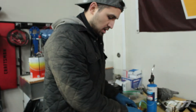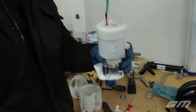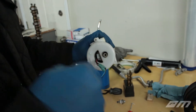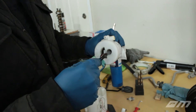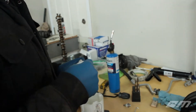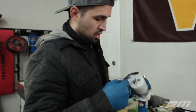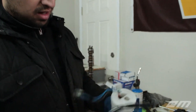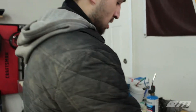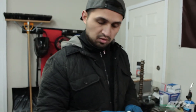Should we just try this setup and see if it works? It definitely is going to pass fuel - I just don't know how much. We did drill out this assembly, so now this housing is pretty much useless. That's where our fuel pump is - we're going to connect a line directly onto that nipple. The one I had keeps on kinking, so I need something flexible like a corrugated line. I'm going to have to get that ordered. It's just going to connect there and use this housing to keep it from moving around. And then we'll have a return-style fuel system.